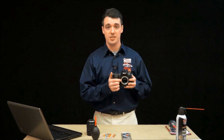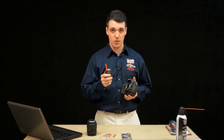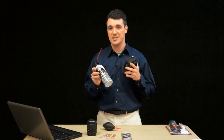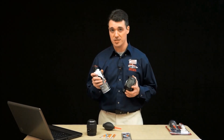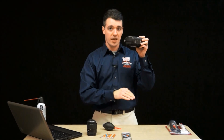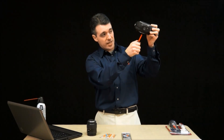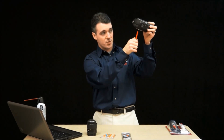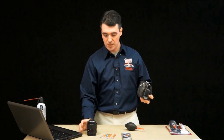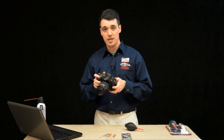You'll see the image sensor here at the back of the sensor chamber. Once that's exposed, we can start cleaning it out with air. I recommend using a manual air blower like this, or some other form of clean compressed air. I wouldn't recommend using canned air like this product, because these types of products contain propellants that can sometimes leak out and can damage your image sensor. Hold your camera upside down so that the image sensor faces the ground, and any dust that escapes is going to fall down instead of entering the sensor chamber. Use your air blower and just start cleaning it out. Make sure you don't make any contact with the sensor itself. Once you're satisfied that you've eliminated as much dust as possible, reattach your lens. Turn off your camera to reset the mirror, turn it back on, and take another test shot.